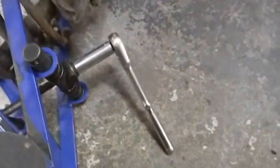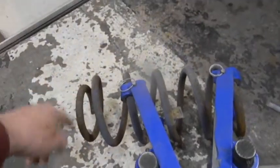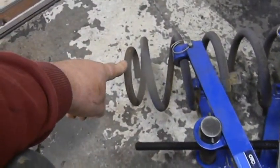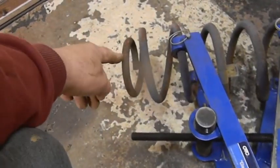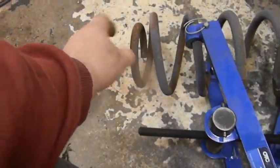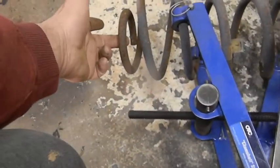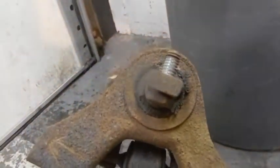I think it went like this - I got it marked. Just like this, okay, because you can see where the end of the spring ends. There is a big end and a small end. In the old days this was the size of the coil. Starting in 1970 when they chopped the top and put the shock coming out the top, they lifted a tight coil and then went bigger. I actually have spacers - aluminum blocks that fit tightly to the bore sticking down - but I wasn't going that route.